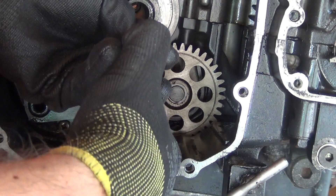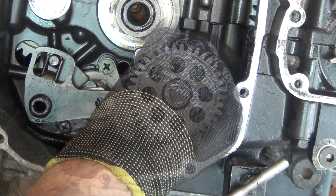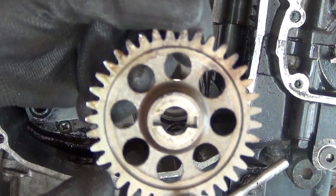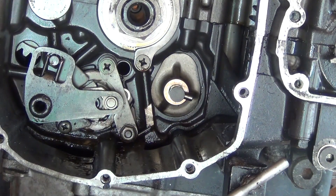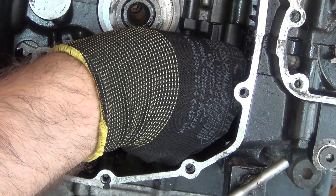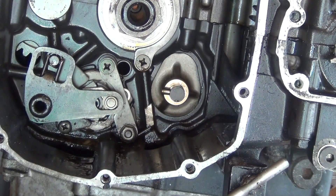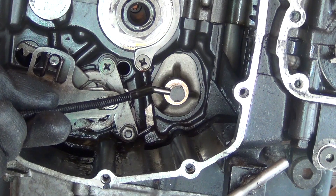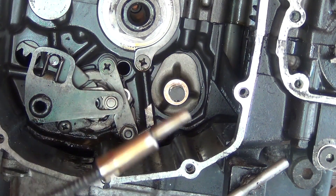And off we go — the circlip comes off. The gear comes off. As you can see, it's got a recess there for the pin, and that pin is right up there. You see this pin here? I'll just grab the magnet. And here we have the pin retrieved.